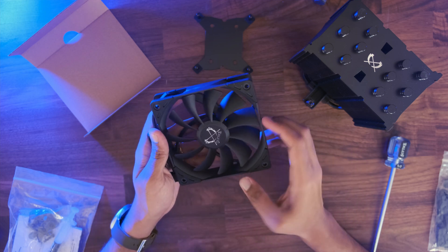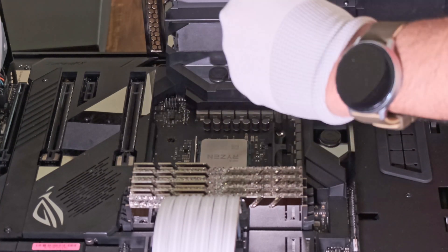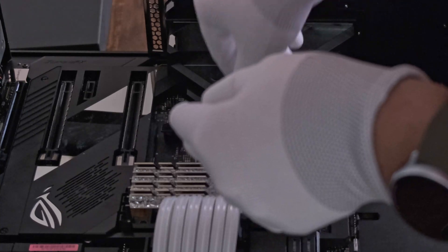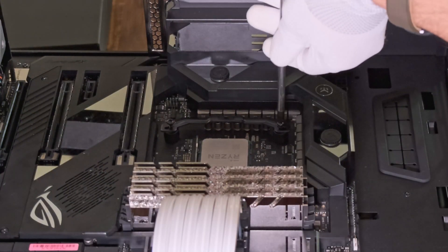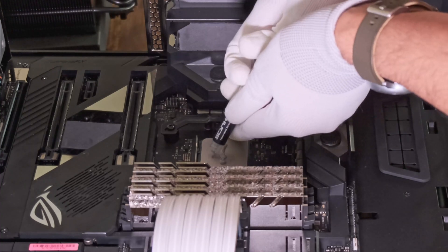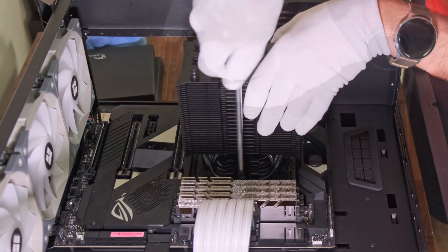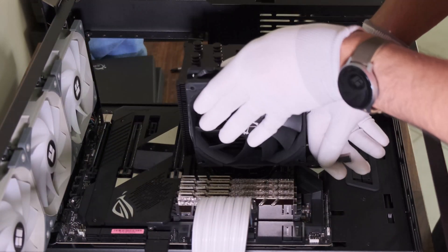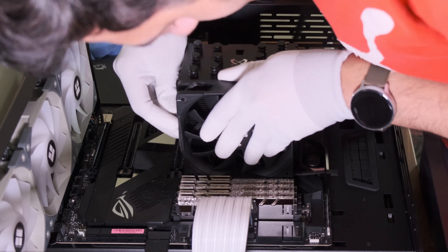Now onto the installation process. I'll quickly show you guys how simple it is to install this cooler on any AMD AM4 motherboard. Unscrew the four screws holding down the default AM4 mounting brackets and take them out. Then place the four standoffs, place the mounting brackets on them, and finally insert the screws and tighten them. Before placing the tower cooler, apply thermal paste. The tower cooler already has the screws on them — just align these screws to the holes on the bracket and tighten them alternately so that the pressure is equally applied over the CPU plate. Tighten the screws until the tension prevents them from turning anymore. Then take the fan with the fan clips already inserted, be sure to route the cable for a clean run to your motherboard's fan header, and simply pull down on the fan clips on either side and they will lock into place.